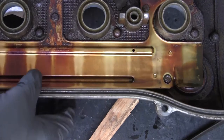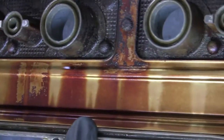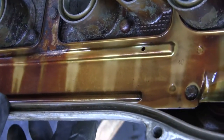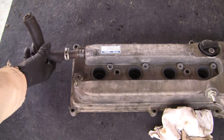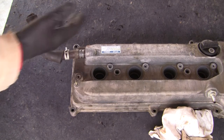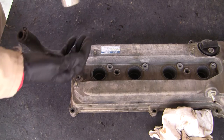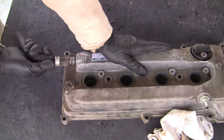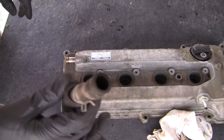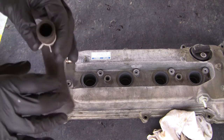Someone might try to pry them out with a screwdriver, but I think that's a bad idea because you don't want to scratch that surface where these gaskets seal. I was having some trouble getting this hose off — it's really hard as well. So I'm going to try the old heat-up-the-hose technique to see if I can get it to come loose. And that worked as well — this was pretty much solid as a rock. It should probably be replaced, but I don't have one right now.